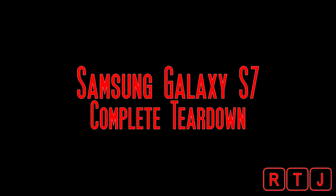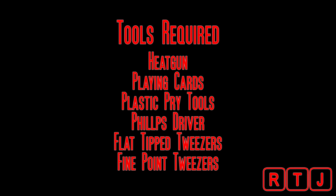My name is Jonathan. Today we are working on the Galaxy S7 and how to tear it down. The following tools will be required for this procedure. You're going to need a heat gun, playing cards, plastic pry tools, a Phillips screwdriver, flat tip tweezers, and some fine point tweezers.